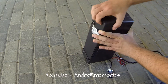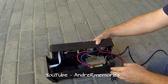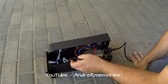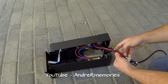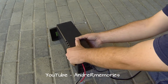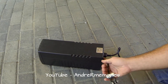The screws have already been loosened, so this cover just clips off. As you can see, this is the inside of the UPS. Normally the small 12 volt battery will sit there and these cables connect to the positive and the negative. I just took them out, took off this back cover, removed these two ports, and then it connects like so. You put this cover back and tighten it. Positive and negative go to these clamps.